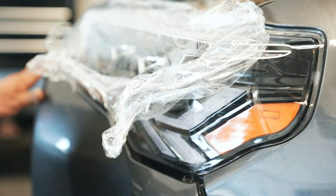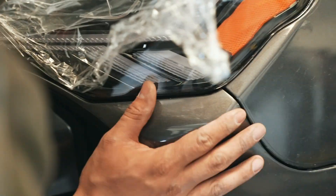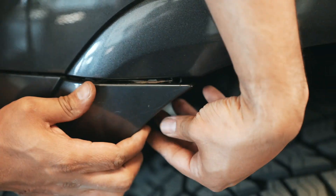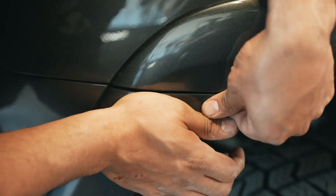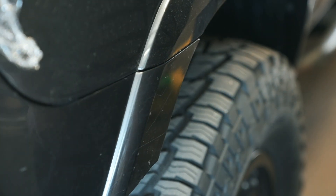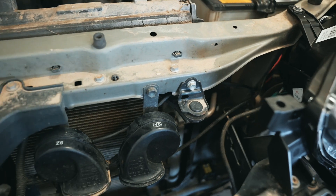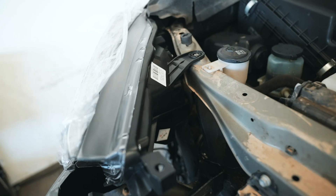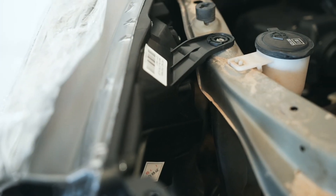Once you have all the hardware reattached, go ahead and start pushing your bumper back into place. This back side will clip in to the little black clips. Then reinstall all your hardware. That yellow connector — or that connector with the yellow grommet — ran all the way behind here and we plugged it into the back of the passenger side headlight where that box is, just like on the driver's side.